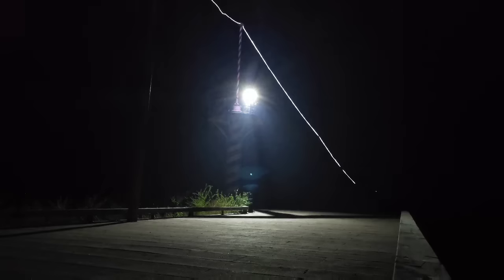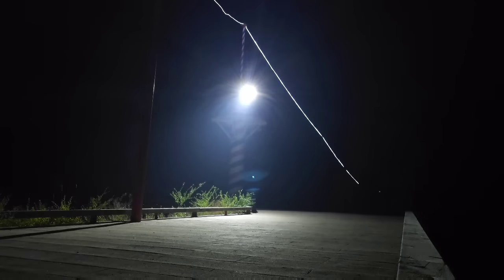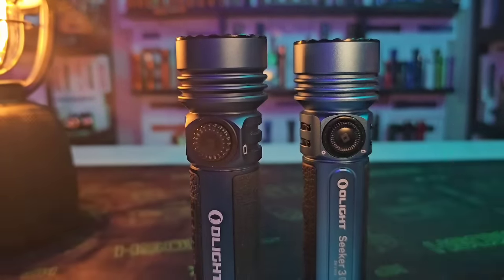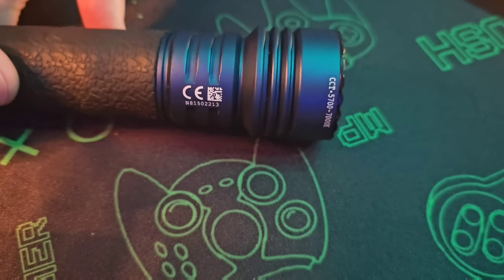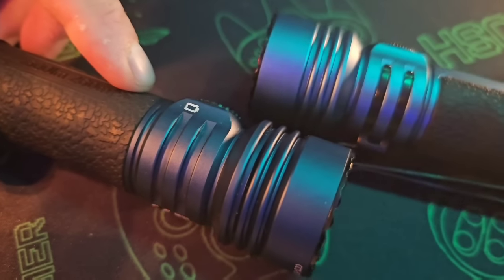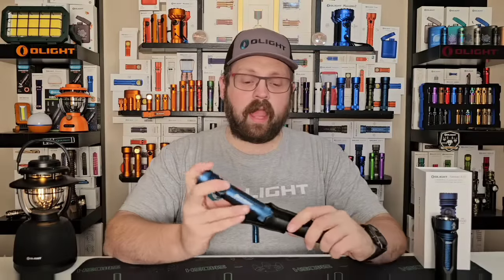The other safety system worth mentioning is thermal protection. There's a thermal sensor in the head of the light that won't let it exceed about 50 degrees Celsius — so if you're running turbo for an extended time and the light heats up to 50 degrees, it limits output to 600 lumens to prevent overheating and protect your hand. Comparing last year's heatsink with its semi-circular cross section to this year's larger, differently shaped heatsinks with more surface area, there's an appreciable difference in cooling. In testing, after activating thermal safe mode the light cooled back to normal operation within just a couple of minutes.